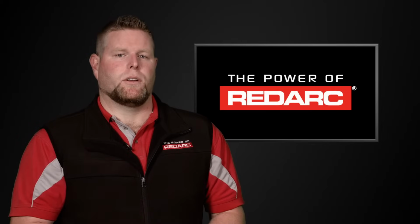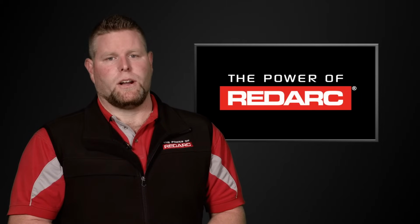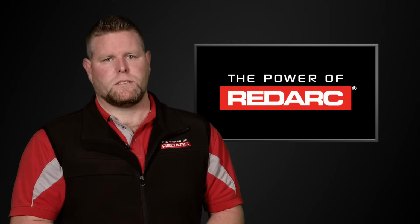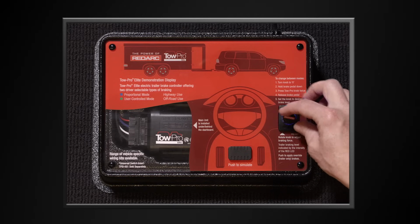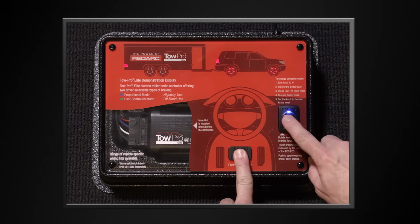The second braking mode on the Tow-Pro Elite is the user-controlled mode. This is great for off-road applications where inertia isn't necessarily the best way to detect braking force. When this mode is activated, the remote head LED will be illuminated green. To change between modes, the vehicle must be stopped. Then, adjust the remote head controller fully counterclockwise to 0, put your foot on the brake and double tap the knob.